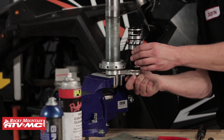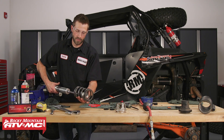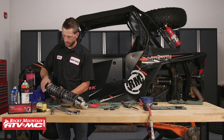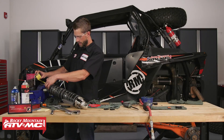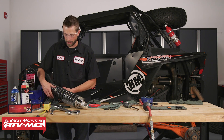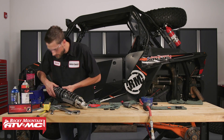Now we're going to set the shock back to our original settings. With our shock placed back in the vise with soft jaws, we can remount the springs. Start with the top spring or tender spring, then the spring divider, and lastly the bottom spring. Slide on the spring retainer, lower the spring, set the bump stop, and bring the spring preload adjuster to where we need it — we measured one and seven-eighths of an inch. The spring dividers have arrows on both sides indicating not just the direction the divider should face but also where the spring coil ends should line up — the top spring coil end will end here and the bottom coil end lines up on the bottom spring.